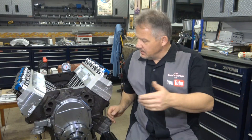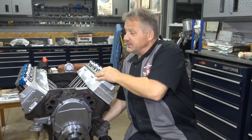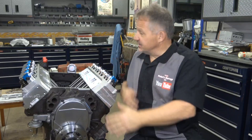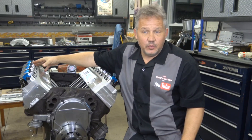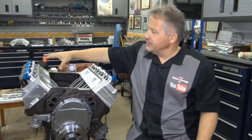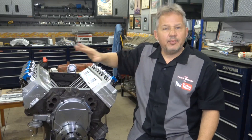Look at the back of the engine first because that's where the oil is going to start to come out. Keep turning your drill motor and pumping oil until you see it coming out the front consistently. Then tilt the engine the other way — wait for the oil to drain back, tilt it that direction, and do the same thing: pump it, look in the back, you'll see it start flowing from the back and work its way up to the front. Once you have oil through all of the journals and rocker shafts and you see oil through the whole head, you're all done — stop priming right there.